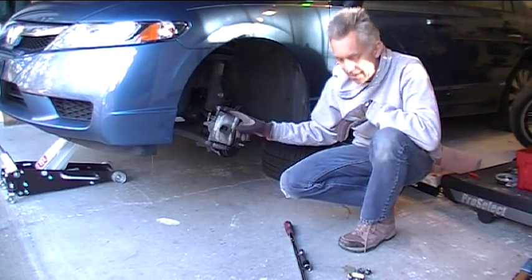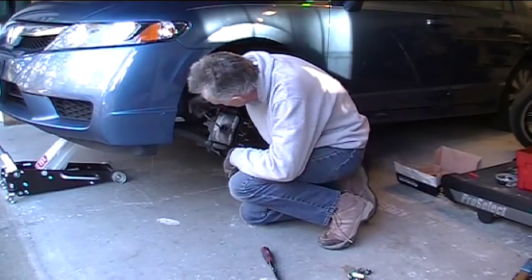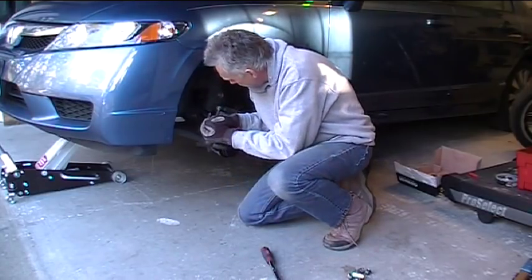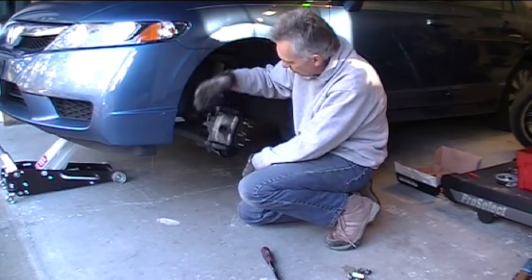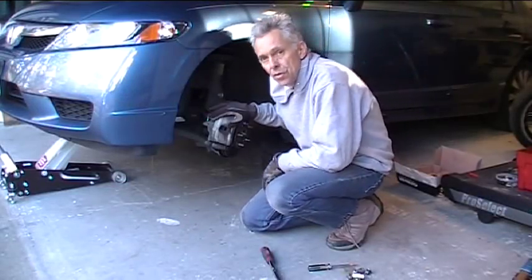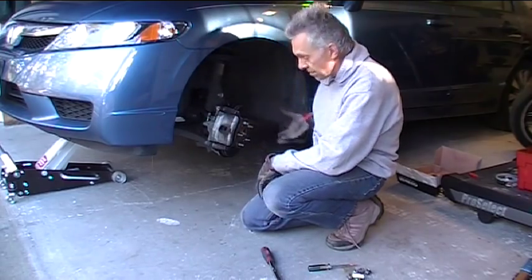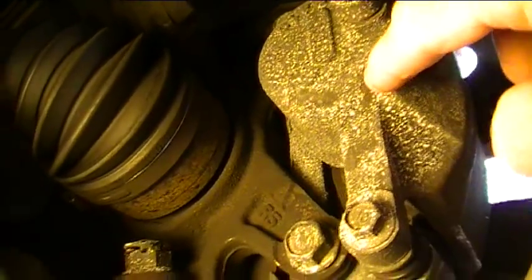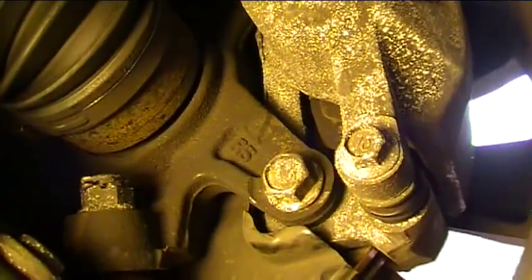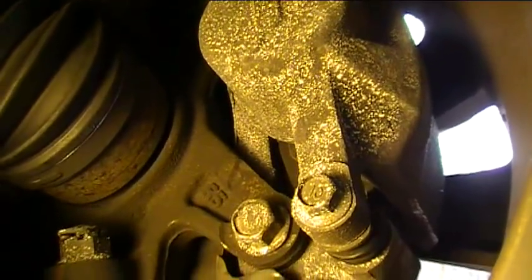You can see that's a little easier to get at now. Just like when I did the brake pads before, I have to get in here and pry the caliper apart just a little bit. Pretty simple to do — just get a screwdriver in there and give it a little pry. That's it, that's plenty. As long as this is a little bit loose, we can just lift the caliper right off the rotor. Let's take a closer look at what holds the carrier for the caliper to the steering knuckle, because we need to take all that off to remove the rotor. The caliper is attached to the steering knuckle by two bolts with an 18 millimeter head. They need to be removed and then we can lift the entire caliper assembly away from the rotor and the steering knuckle.